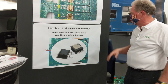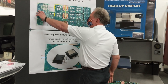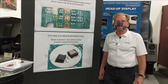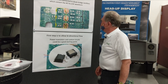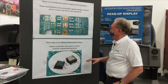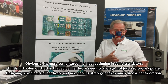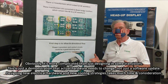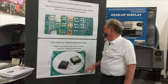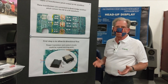The first step Tesla would need to take is implementing bi-directional flow, meaning power could flow out to run the car or flow back to charge your house or help a stranded EV driver. What you're looking at here are transistors — the type needed for bi-directional flow. That would allow taking power from the DC side and sending it back through as 220V AC alternating current.